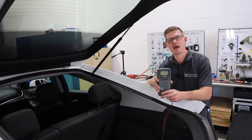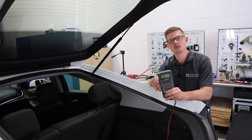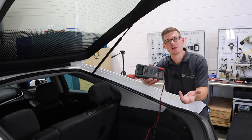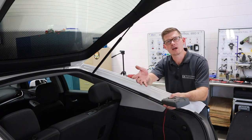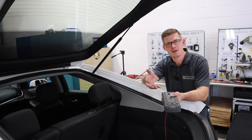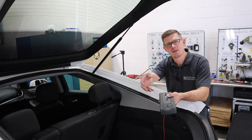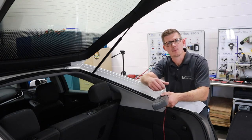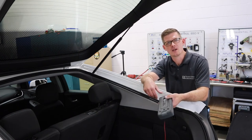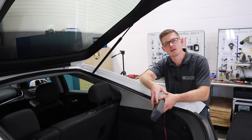That's our process for testing a 12-volt battery in a vehicle. It's important to recognize the different tooling and where they all fit in the sequence. Checking open-circuit voltage with a voltmeter is a great start and gives an indicator of the battery's potential. But we've got to keep in mind that current output is the ultimate goal, so if we can put a load on that battery, that's always going to yield better results. Make sure the battery is strapped down properly, that the terminals are clean, and that there's no leakage from the post area creating corrosion — all these things can create resistance and voltage drops causing slow cranks and other issues.